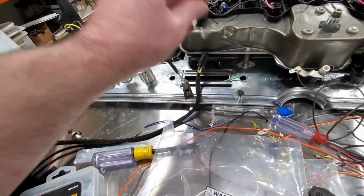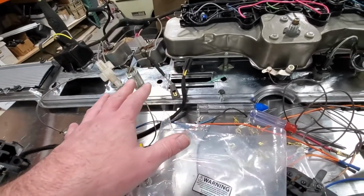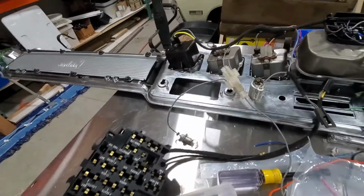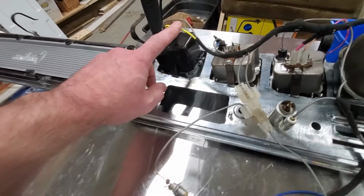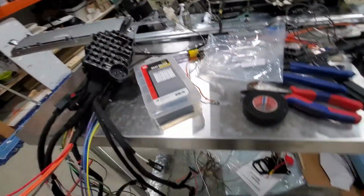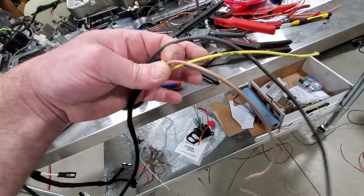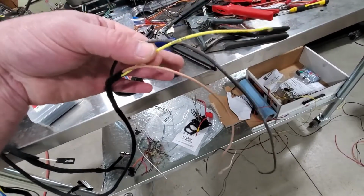And then this bulb is going to go in the back of the heater. It's the only thing for the heater that's going to be common here. Remember, I'm redesigning the way that all works with the Classic Auto Air stuff. This is the new quartz clock, so it's going to always have a constant feed. It has its own fuse right here. Now that clock line is also shared with the radio for its memory feed. So we're going to have a 10 amp line going to the radio and a keep alive memory basically for the clock.